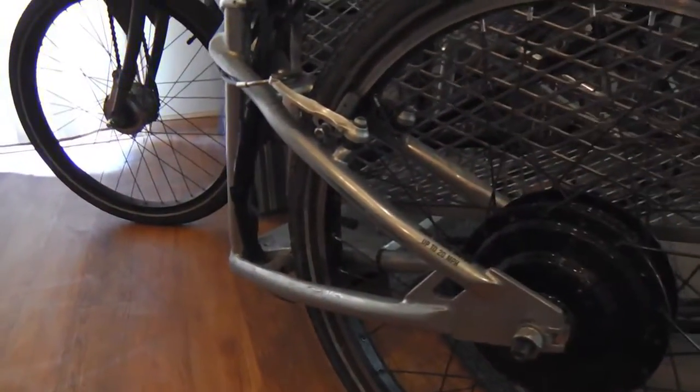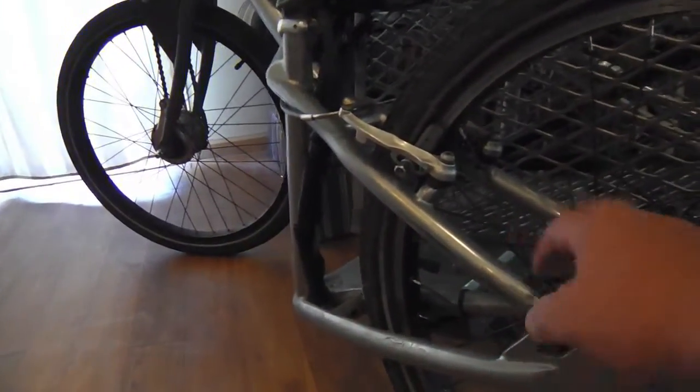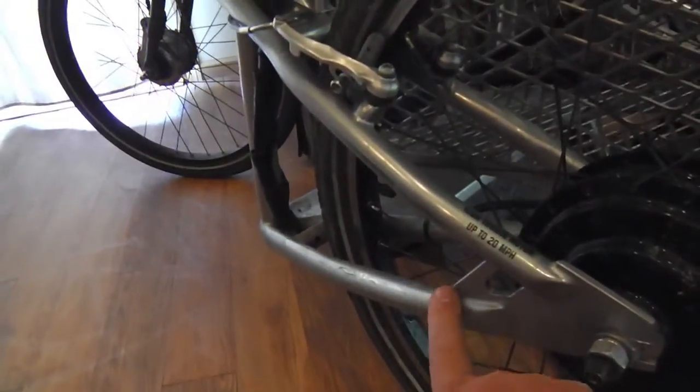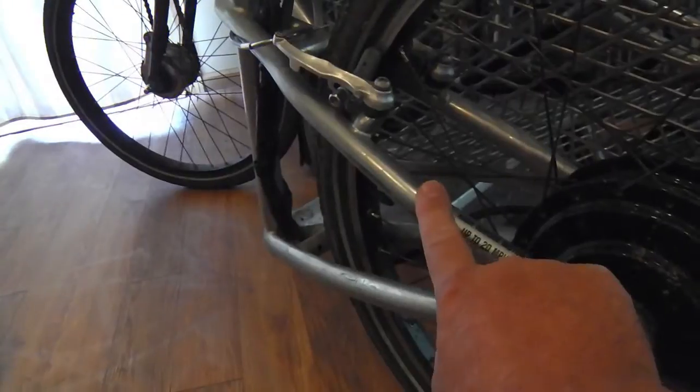But anyway, here we are, and as you can see, I've used a couple of existing bicycle frames. They were brand new. I bought two brand new bicycles and chopped them up and used the tail sections for this trike. These A-arm looking segments here have a couple of tubes running down, so there are four prongs going to each one of these hubs. I don't think that's necessary. I think with these two lower ones plus one here, that would be enough.